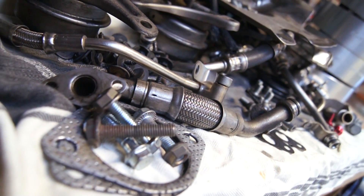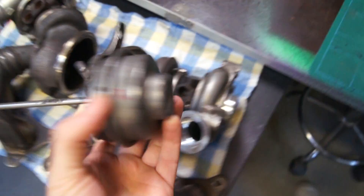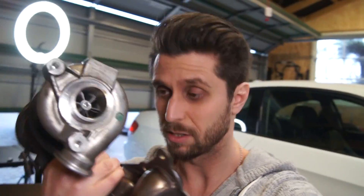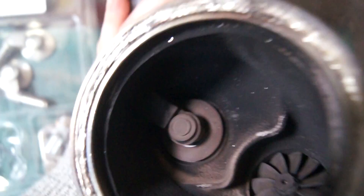For the flapper kit, it's important you get the right one. There are some Chinese ones knocking around which might be okay, but to me it doesn't make sense. I've got a link in the description for the steel ones that I bought. Once you've got your turbos off, you can remove this piece to get it out of the way and you're left with this unit — the wastegate, the turbo, and the manifold. We're replacing this arm here, we're doing the flappers which is the bit that rattles most likely.